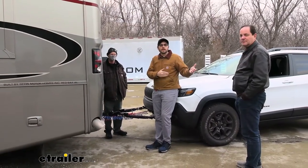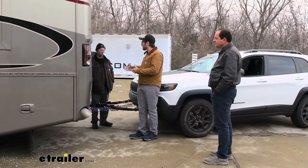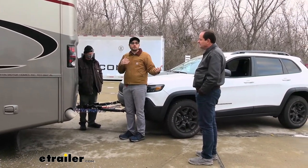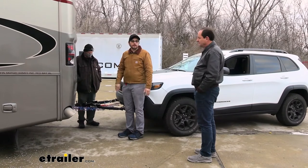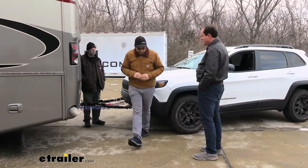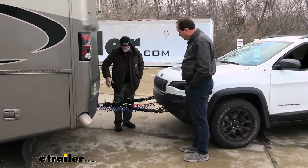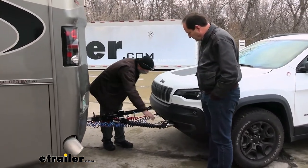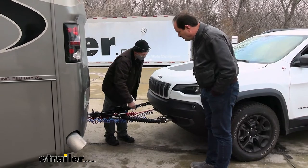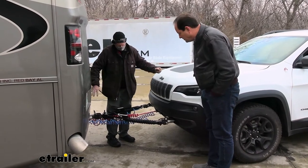Here we have Pat Hayden with his motorhome and Jeep Cherokee getting a tow bar setup walkthrough from Joe. Joe explains that flat towing is similar to pulling a trailer — the connection points are on the base plate arms instead of a coupler, and instead of a pin and clip you use barrel key add-on locks. Right now the tow bar arms are stretched out, and when that happens they won't move freely — you use the lever to break them apart before disconnecting.